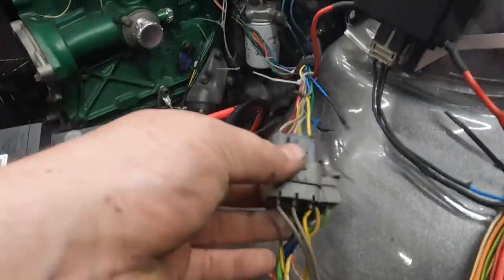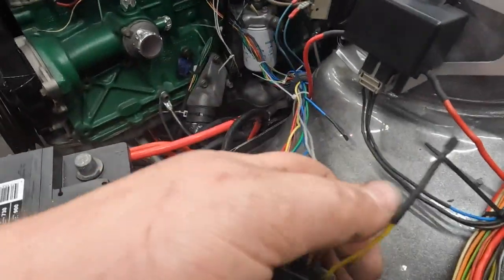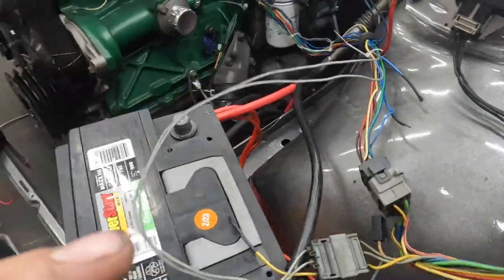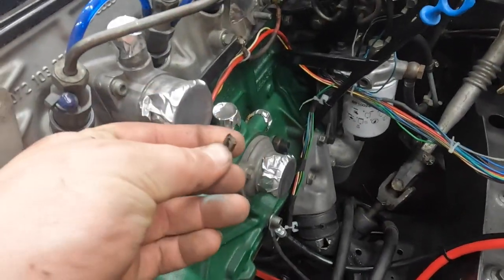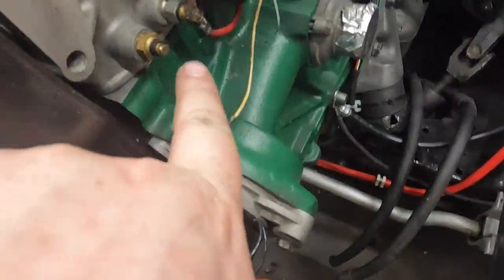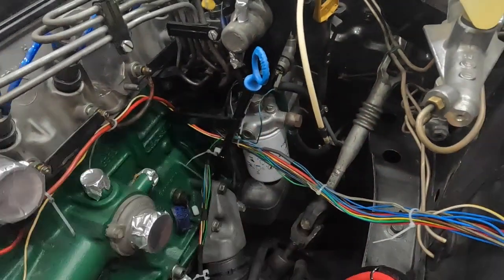Those go to this little three-pin connector, and the only other wire in it went to the EGR nonsense, so that can go away altogether. We'll be about done up in here once I go ahead and clean up all the little spade terminals — got some new ones here, just to keep it locked on there a little nicer, same as the shutoff solenoid and the altitude compensator.